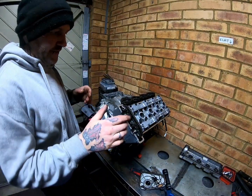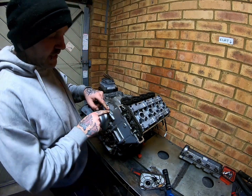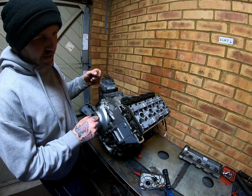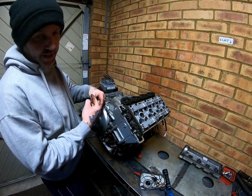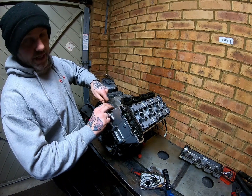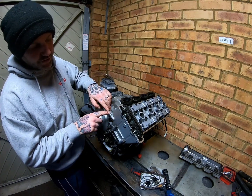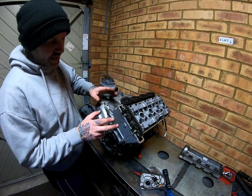What we're going to do next is release the tension off of this. The way of doing it is just unbolting it basically. When you're doing it back up, you've got this 10mm bolt on the back. You undo this plug, and you get a small flathead screwdriver in there and wind it clockwise, and it'll wind the piston back. Then you jiggery-pokery it in, holding the spring tension on it, getting the bolts done up, and then I put a bit more tension on it, winding it back a little bit more, and then I pull the screwdriver out so it just drops the piston against the guide, and then it's set.